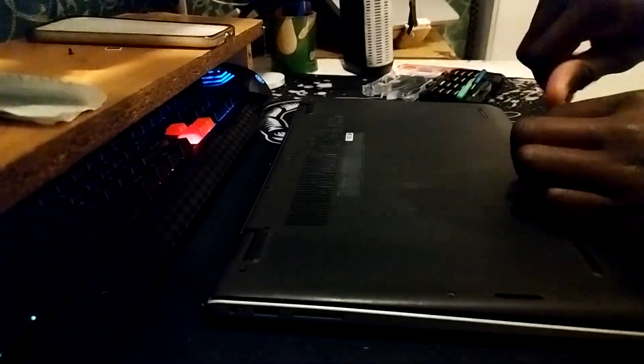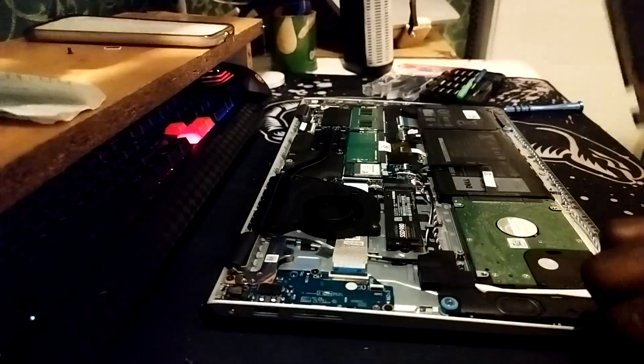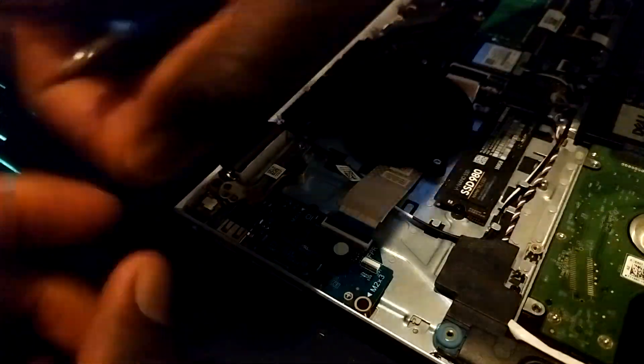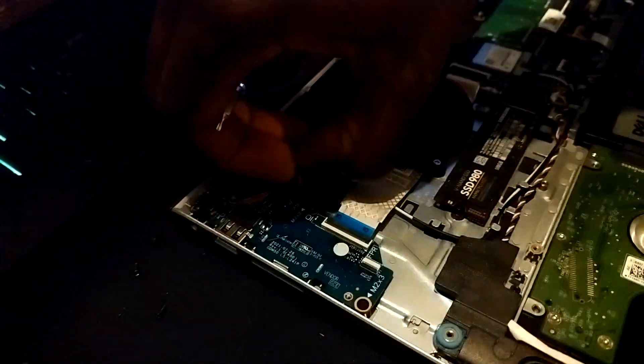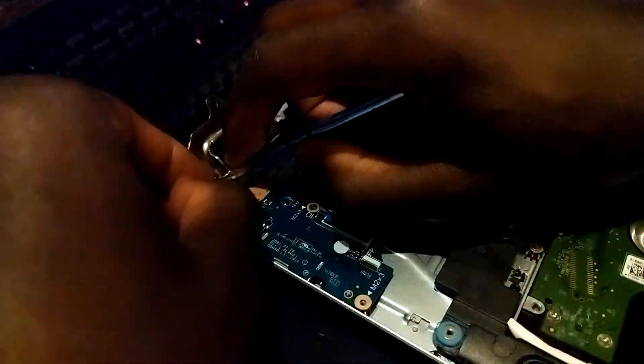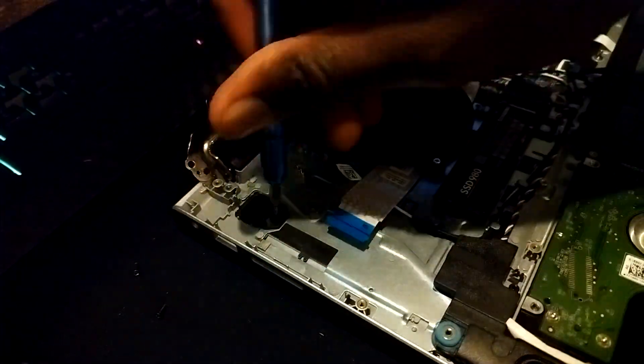What we're doing is opening up the laptop to install the new fingerprint sensor. I got it from AliExpress, so I'll put the link in the description. Obviously make sure you unplug the battery before we continue. There are two screws holding down the hinge, then three screws holding down the little sub board, and obviously remove the connection to the main board.